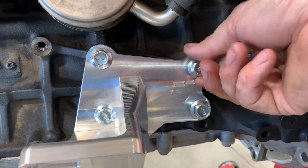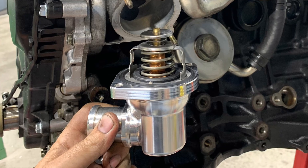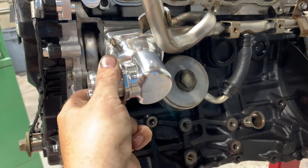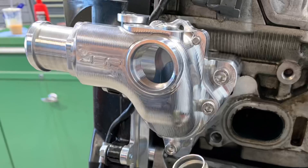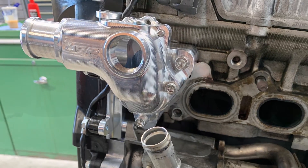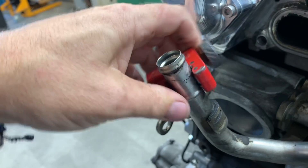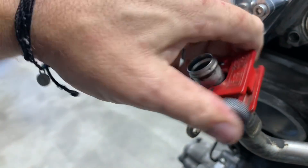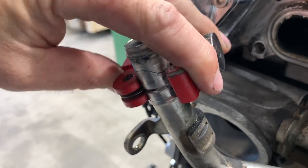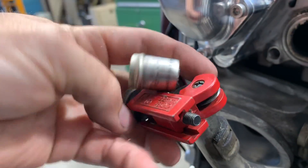After reinstalling the oil pan, I'm going to mount the engine mounts onto the engine, followed by a new thermostat. I'm going to use one of our short thermostat housings — it makes routing the lower radiator hose a little bit easier when doing the swap. Next, I'll install our upper water neck, which makes the upper hose easier to install, but you're going to have to shorten the bypass hose a little bit. I like to use a brake line cutter and work it down until the end of the hose breaks off, which makes routing the hose really easy.